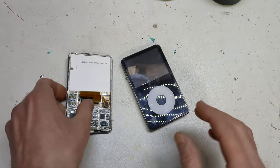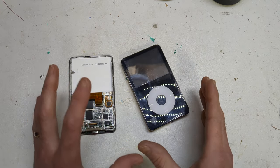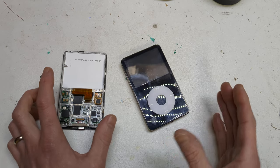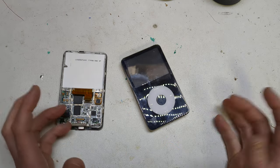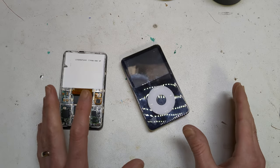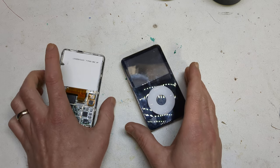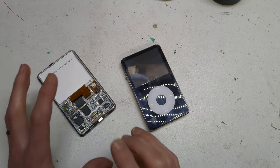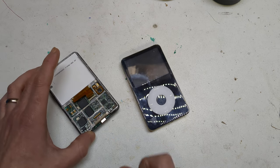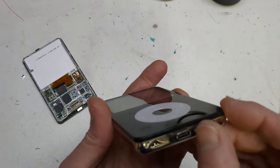When I was doing the Bluetooth mod, I hooked it up to the internals and then I realised that the Bluetooth was always connected — it was always sucking power. After a couple of days it would just obliterate the battery. And with these iPods it takes forever to charge, so this was not going to be good. That's why I added a little tiny switch. It took me ages to find the tiniest switch that would fit next to here.